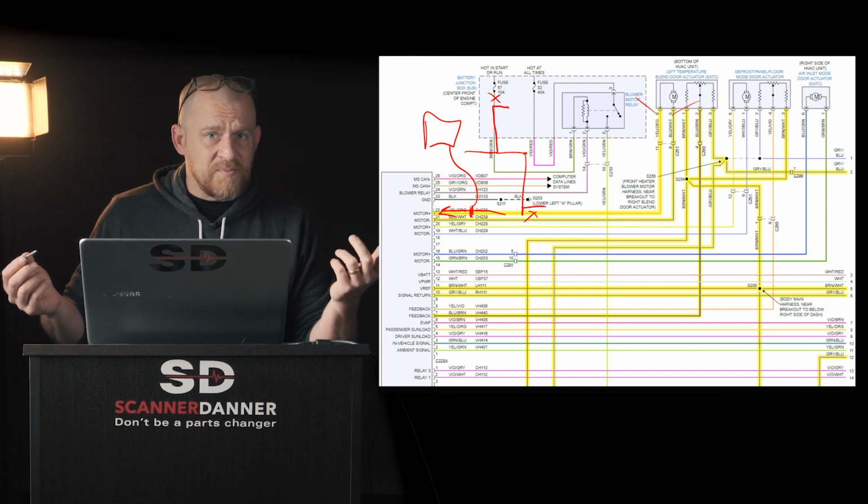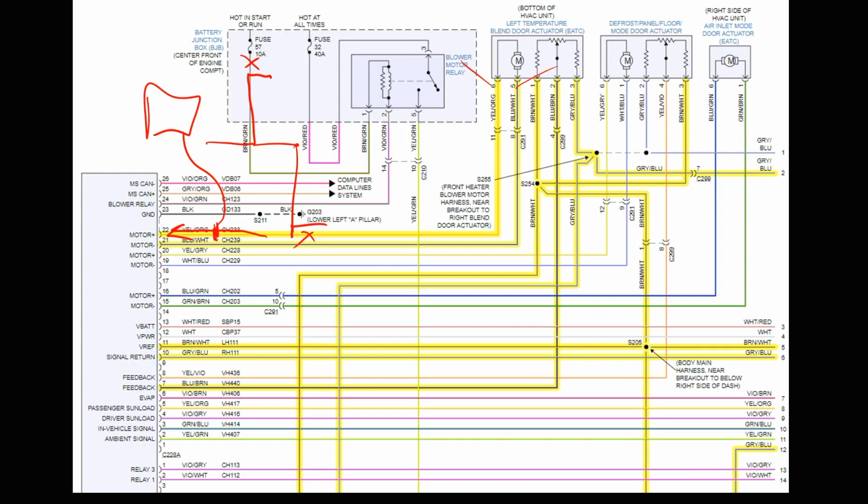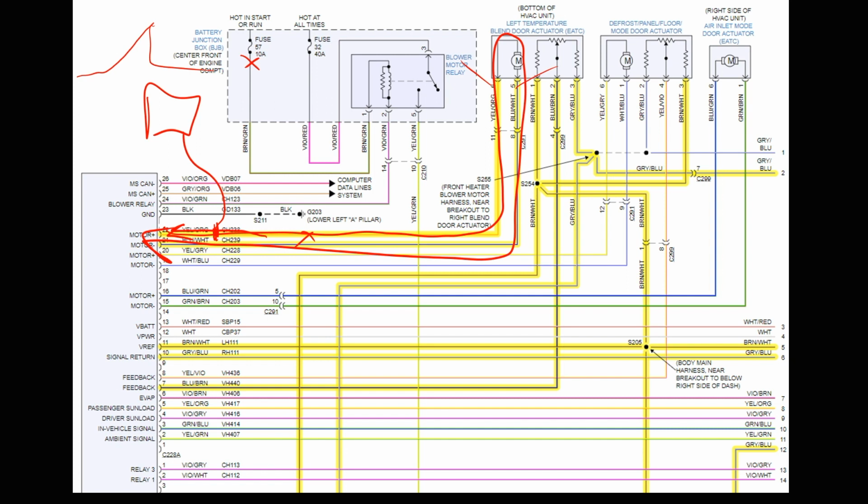They're having you do resistance measurements, typical flow chart. But that amperage measurement, again, if you have current flow, you have to have a complete circuit for current flow to be there. If I see amperage on my, I'll just draw a little kind of triangle ramp. That's not what it's going to look like, not for an electric motor, but just for a visual. If I see that, how is my wiring? How's my motor? How's my control? How's my module? It's all good. That motor should be moving.